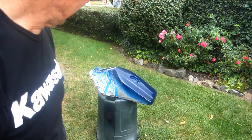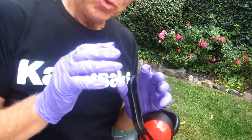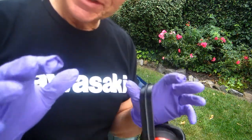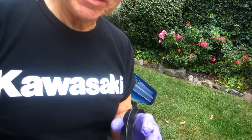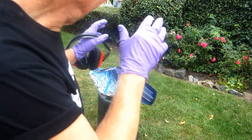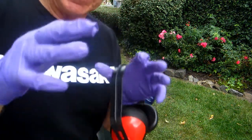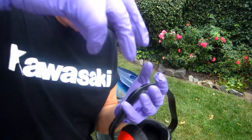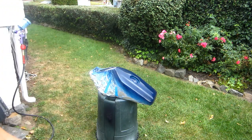The world's loudest compressor. The trick here, and just to see what I want to do, that's a very light coat. It's going to need three coats. Give it plenty of time to dry. While it's drying, I'll put the black on those handlebars, the gloss black, because it's the thinner that goes down and attacks everything. And the thinner you make the paint, the colder the temperature, the more penetration it gets, and the more problems you can potentially have.